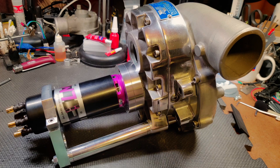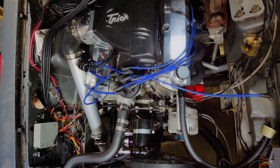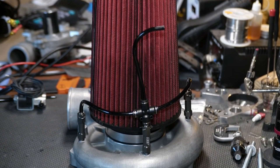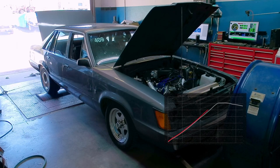Now let's look at the Sledgehammer — effectively an electrified Vortex. It features a healthy RC motor made by German company LMT that develops 53 horsepower, drawing 670-something amps at 50-something volts depending on voltage sag. There are six connectors, and it's effectively direct drive. Installed, you can see the heavy cables powering the motor next to the throttle body intake elbow — the cables weigh more than the actual unit. There are three methanol nozzles that inject into the volute of the compressor, which helps improve compressor efficiency. We took it to the dyno and it made more power.